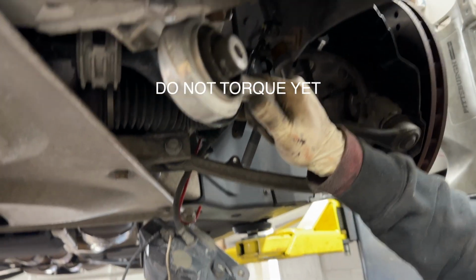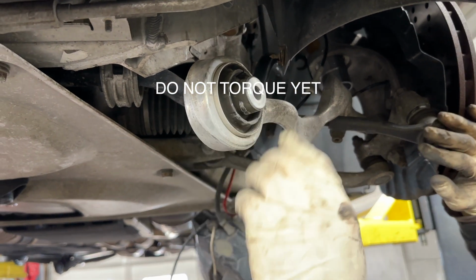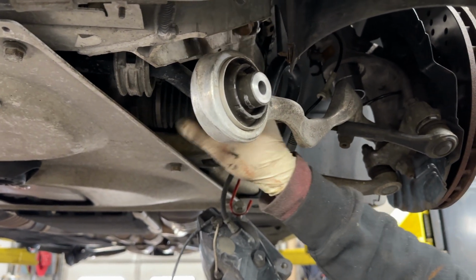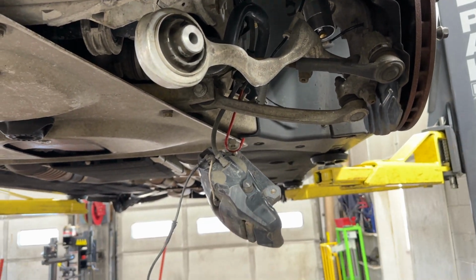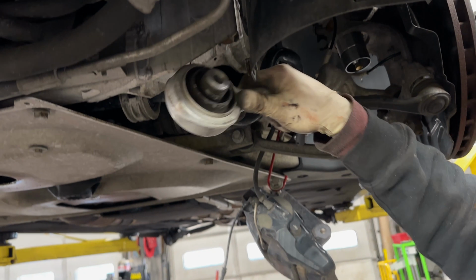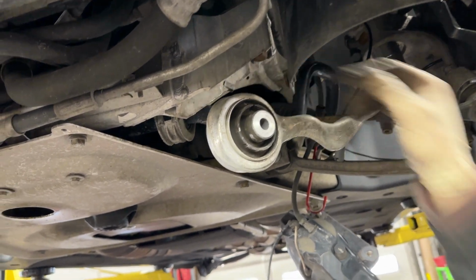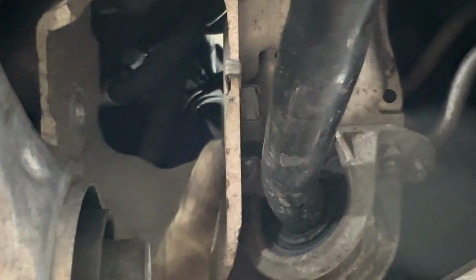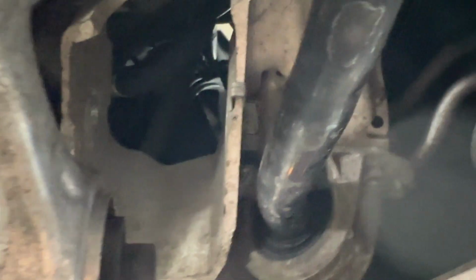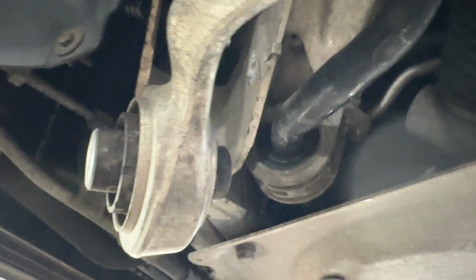Lastly, we'll get this tension strut in. It's the same concept, but this tension strut only has a bolt, I'm sorry, it's not an actual bolt and nut, it's just a nut, because the actual nut portion is this little clip that's clipped onto the side of the subframe that actually has a thread built into it. It's right here. The good thing about this design is that since it is a clip, if you did accidentally start to cross thread it, this will push itself out so it won't actually destroy it. So it's very easy to find this thread.